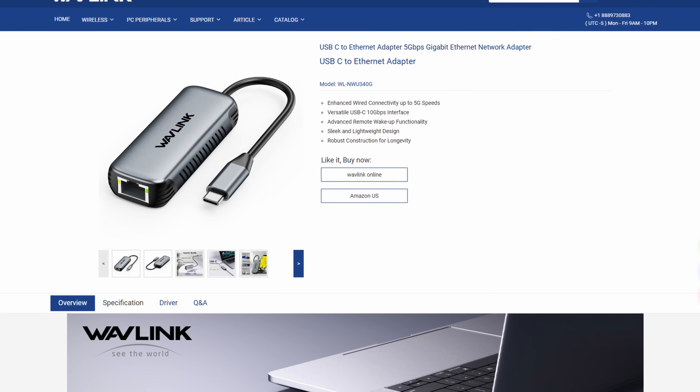There are USB 2.5 and 5 gigabit adapters you can plug into a NAS, but as soon as you plug one in, it will not be recognized. You have to go out of your way to install additional unsupported packages — unsupported from Synology. You could run into problems during installation, or physical issues with your NAS. And it might work today but not necessarily tomorrow. The benefit is they're super cheap — like $20 or $30. Robbie over at NAS Comparers did a video on a 5 gigabit adapter walking through why you'd want to do this and how to configure it — I'll leave a link in the description.